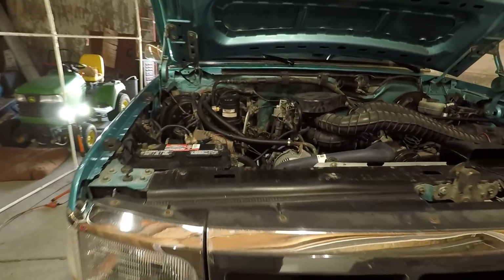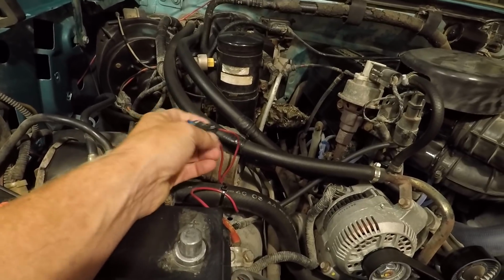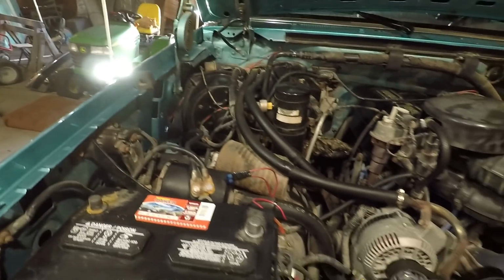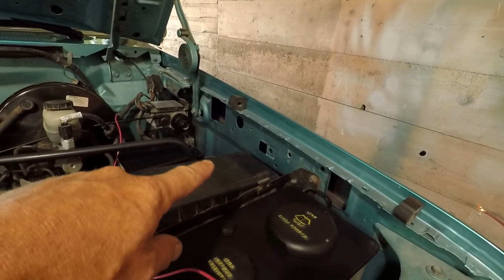And I also have some relays, fuse taps, wire loom, and there's something else. There's four things I ordered. I don't remember what the last one is off the top of my head. Okay, relays, fuse taps, wire loom, and then a fusible section to go from like the battery to the relay, and it has a fuse built into the wire. You'll see what I'm talking about, but instead of doing something like this, it has a little box that you put a fuse in and you close it up. I think that'd be better than this. Not exactly sure where I'm going to put the relays. May put them over here, like right down in here somewhere, or might actually be more room over on this side. We'll figure it out.